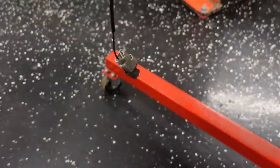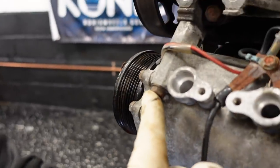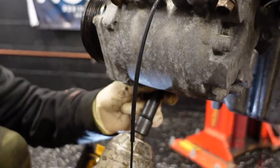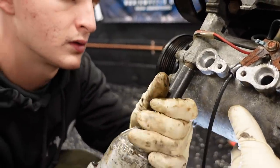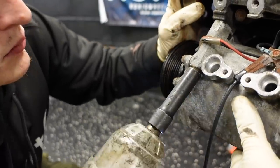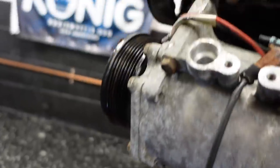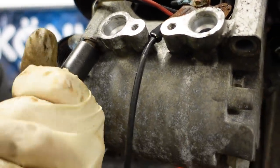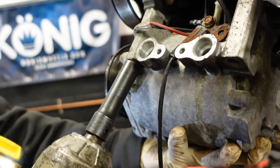AC compressor. So you've seen, you just made that mistake. So go bottom first, so that this 12 or this 12 can hold it up for you. So when you take off that bottom, now you know these are the last two that are holding it. Take your time. Move on. Okay, now figure out why that's not fitting. Easy, yeah, it's just gunked up, go ahead.